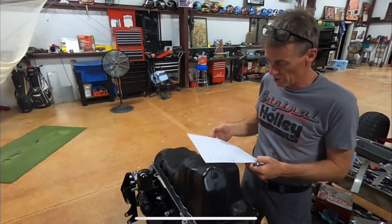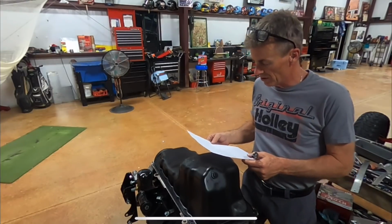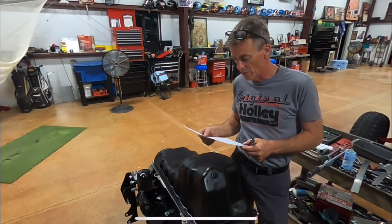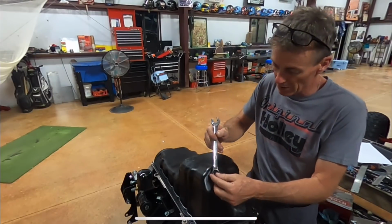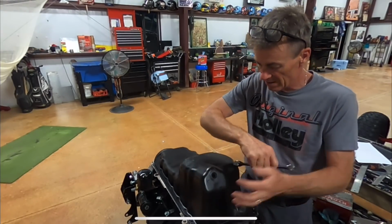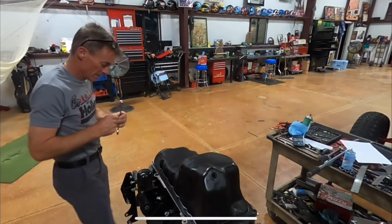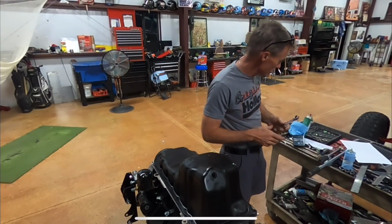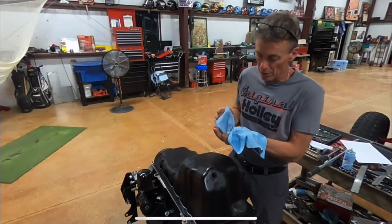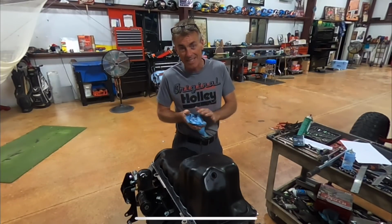Golly, I'm gonna have to actually get this piece of paper over here. Mark Van Eiderstein. What's the crew doing while the car is on the jack stands when they start it? Well, essentially what's happening when they start the Parts Plus Top Fuel car while sitting on the jack stands is a variety of things. Throw that right on the floor. Probably one of the most important things, especially after you just did a 45-50 minute engine rebuild, is checking for leaks, checking for oil pressure, and setting the timing.